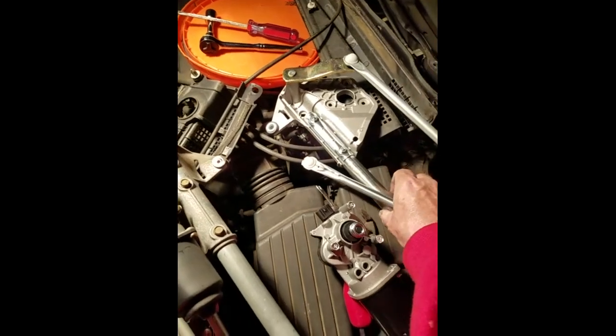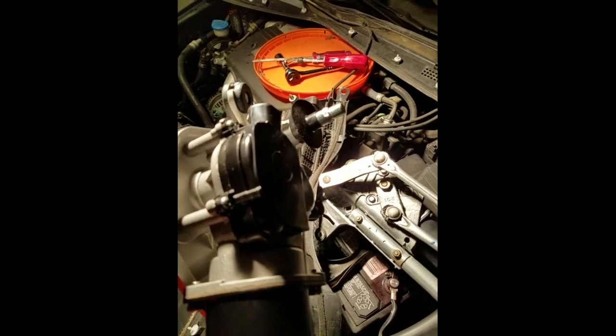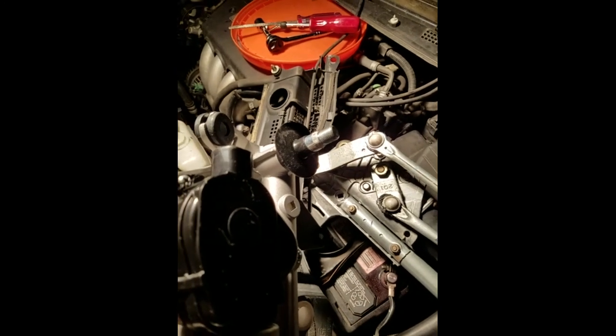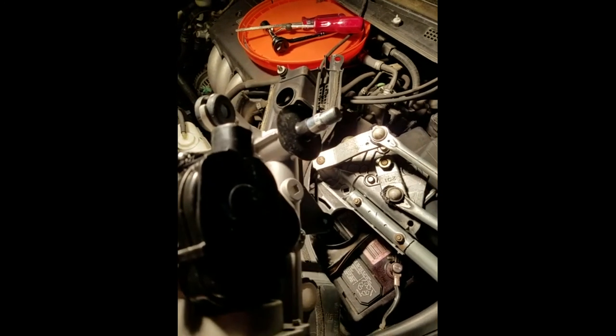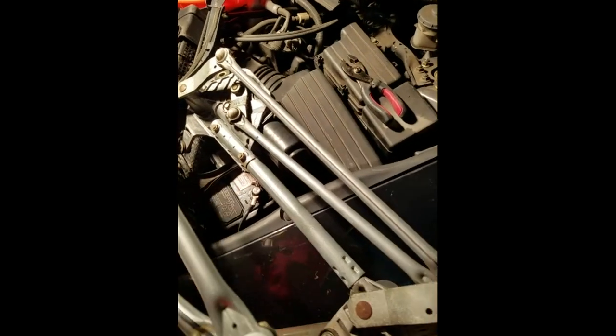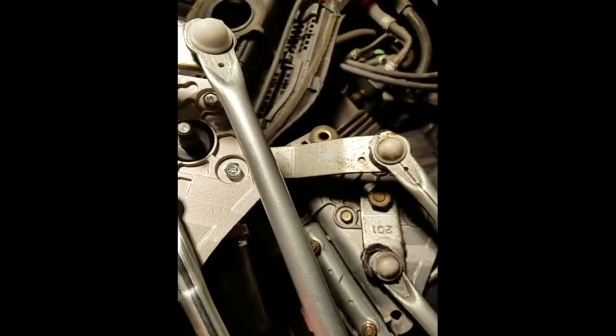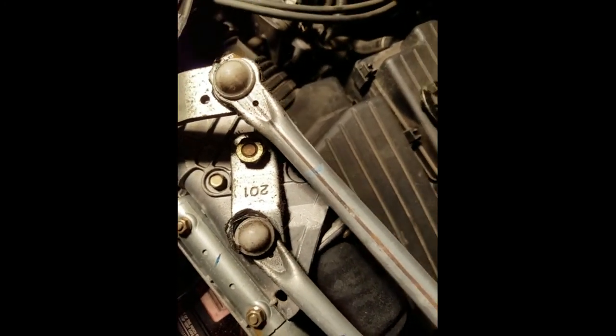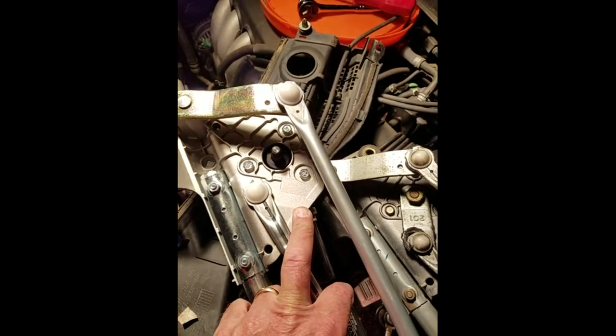There may have been cheaper fixes to patchwork some of this, but since this car is my daughter's and not staying in town, I just want to make sure it's done right. Replacing the new motor and fully new transmission means new threaded parts — hopefully it'll hold up without problems. I did notice one thing when unpacking the transmission: we are missing one arm. There's no way to connect the linkage to the motor drive, so I'm going to take that arm off the old one — it should fit perfectly since this is an OEM spec part.